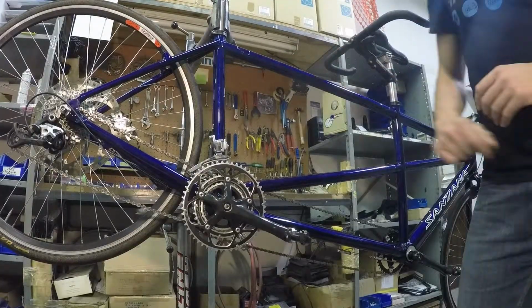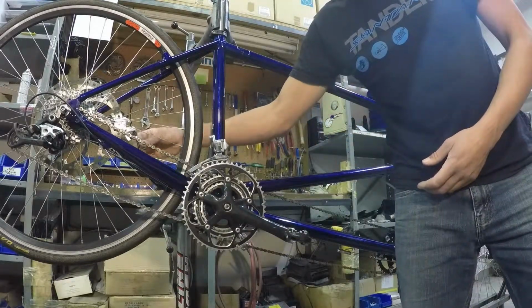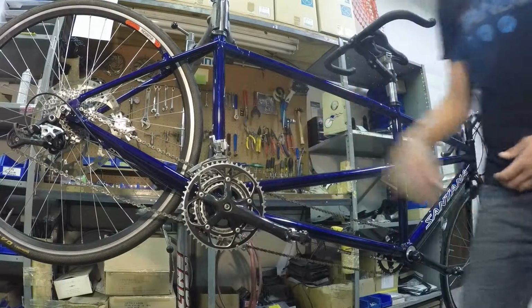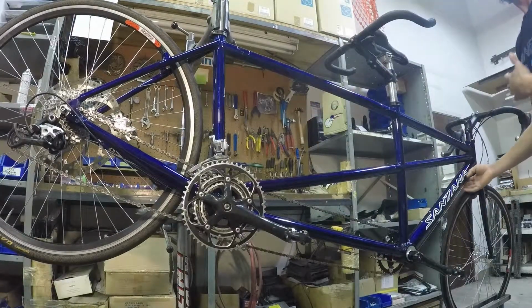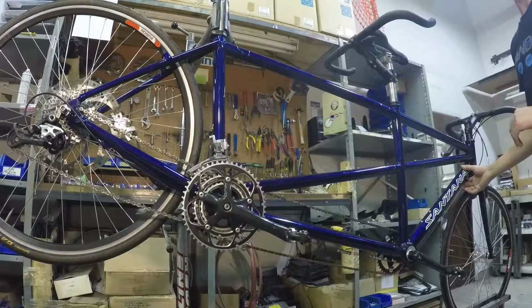Now the rear brake shouldn't require any readjustment. It has its own barrel adjuster back here, which is the one that you should have been using to adjust cable tension. So the front barrel adjuster should have been left screwed all the way in, in which case the boxing and unboxing the bike hasn't changed the adjustment at all.